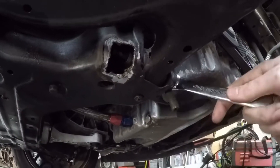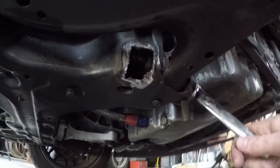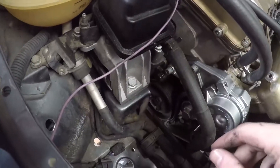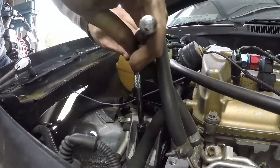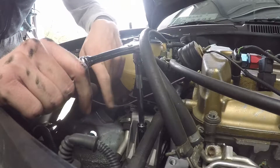That did it. As you can see, this bolt is starting to come out and the bung is actually staying still — so I did enough welding. I'm going to remove the two bolts on this motor mount to get it freed up. Since I'm pulling the motor mount bolts, I'm going to go ahead and support the lower side of the motor.